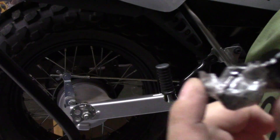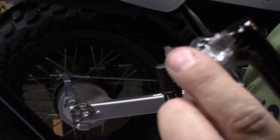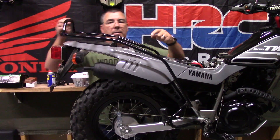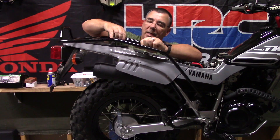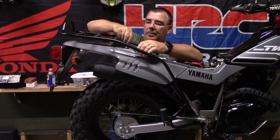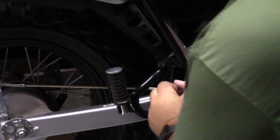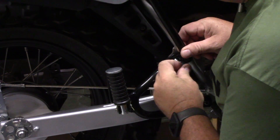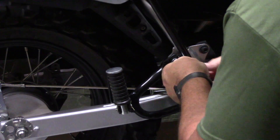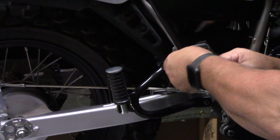Now we take our rack and you can see there are some taped-on bolts — those are the bolts that are going to replace the ones we just took out; they're actually a little bit longer. Here on the top, on these two holes, we'll go ahead and put our original OEM bolts back in, but don't tighten them up yet, just put them in so we have room to move around. On this side, we'll put the longer bolt in here — I believe this should go on the outside instead of behind this — and we'll snug it in, not tighten all the way yet, then put the other one on the other side.